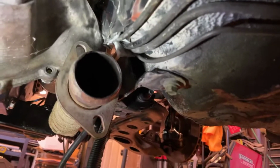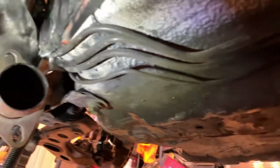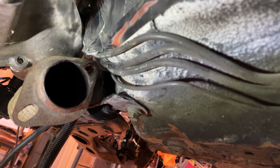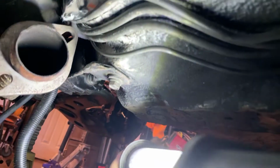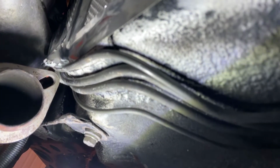Okay, now we're under here. Try to see what I can do about the light. But so you can see where the OEM lines run under here and turn and go to that corner of the car, and then you can see how closely they run. I'll try and hold this. And I probably should have paid more attention to this when it was together the first time, but I had a lot of other stuff in my mind. I thought when I get to here, I'll just wing it. And now that I've seen it, it's not really something I'm willing to let go. There looks like there's about 3/8 of an inch between that flange and the fuel lines, and so something's got to give.